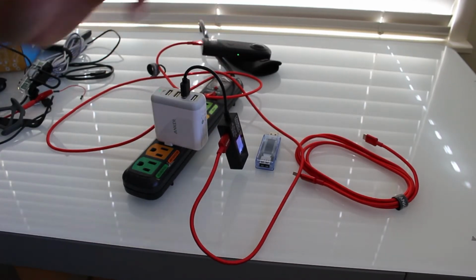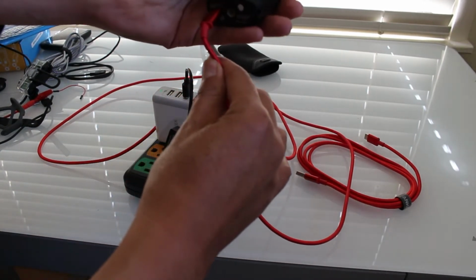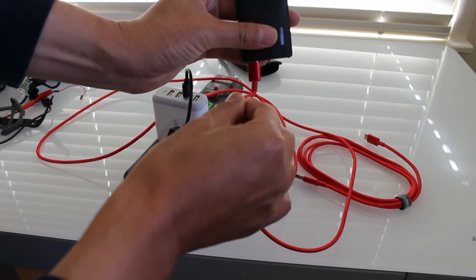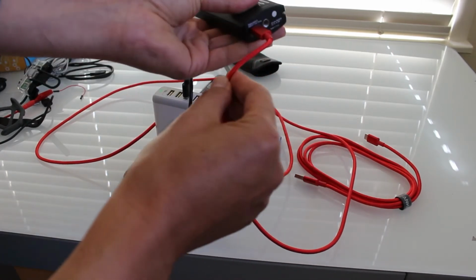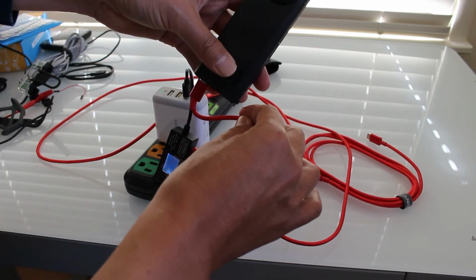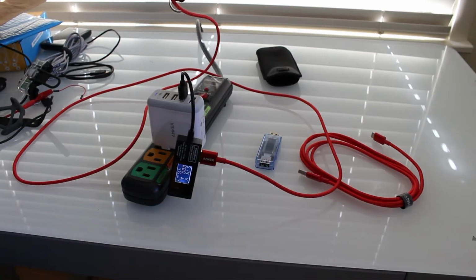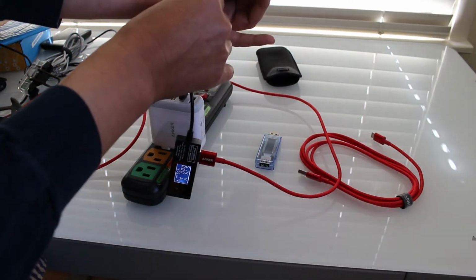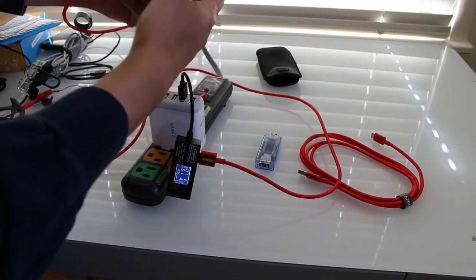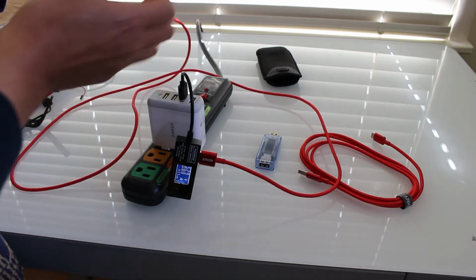In addition to different charging states of the camera, we also tested for real-world conditions, where maybe the cable might be bent, possibly changing the resistance of the cable. This did not seem to impact the charging ability of the cable or the charging unit. Regardless of whether the camera is in sleep or on, the current going through it always appears to be over 500 milliamps.